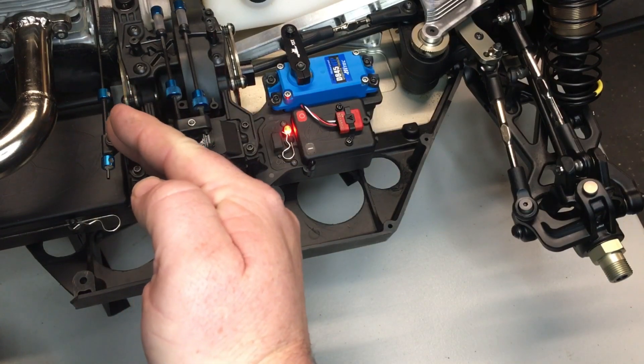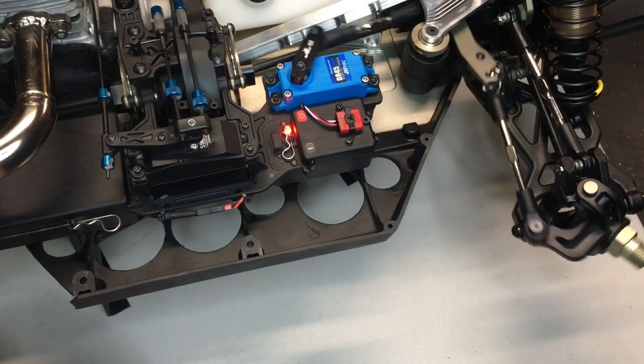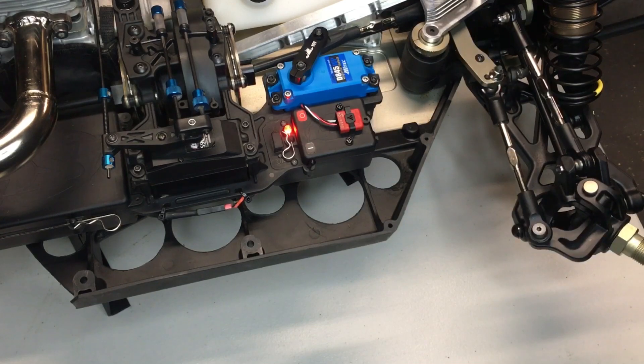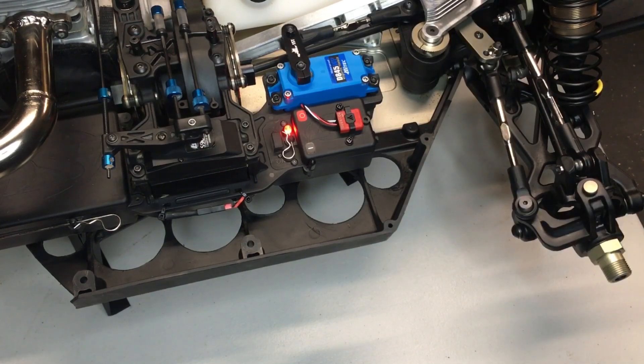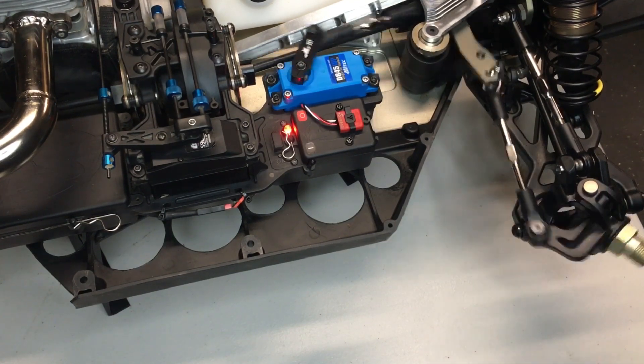You set that endpoint so it brings the arm back to the end of the throw on your steering arm without overextending it. Hold it to the left and keep pressing forward until it stops. I'm going to put it back about two — 98 was probably the max and I'm taking it down to 96 so that way there's no extra stress. Now going right — it seems good right at 96 as well, so I'm going to do 96 both ways.